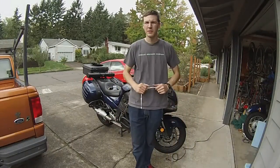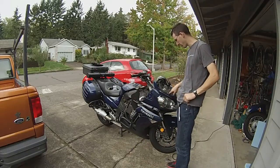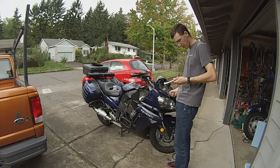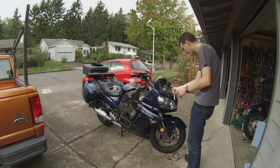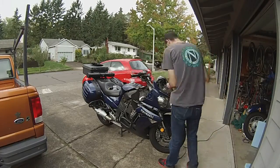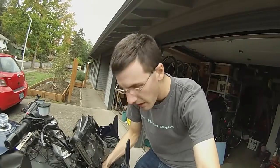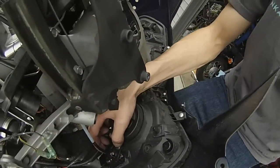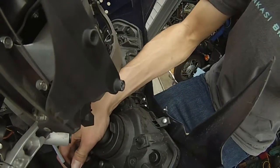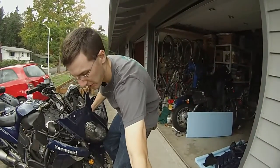Here's a little tip in removing all the fairings. Right down inside of here, after you've removed all the associated plastic, there's an 8mm bolt. When you're removing the headlight up-and-down adjustment cable, if you look down in here, all you've got to do is untwist, pull out, and that undoes the cable. Got to get the rest of this thing apart.